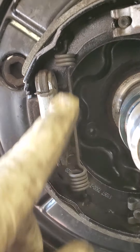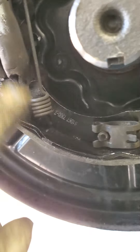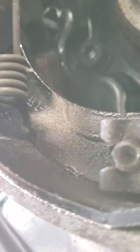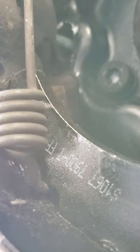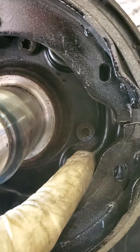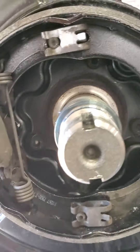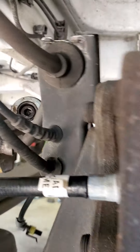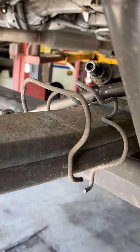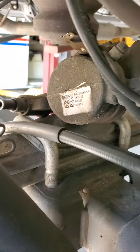This is your main spring — it holds the two shoes together. There's a little hole right there. There's a little hole right there and it goes in. This bracket is where the emergency brake cable comes through. See it coming through there? That's the cable right there. In order to get that cable off, this has to come off — this backing plate has to come off. You have three 6-millimeter Allen screws to get that off. Take something and just hit the front of the cable — the parking brake cable — and take a screwdriver and pop it out from behind. You cannot get it out unless you take this retainer off, and this one here, and there's another one there. Then you have enough to just pull the cable out.